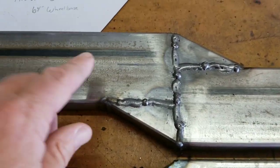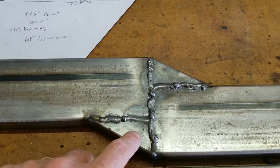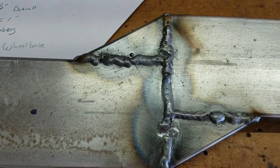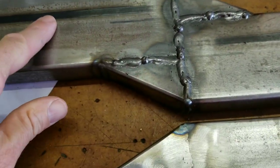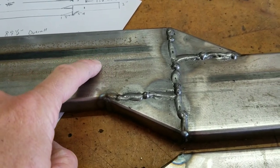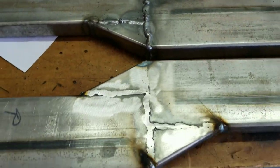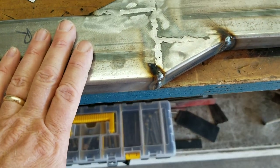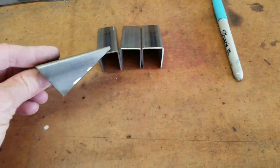My welds got progressively better and better. You can see some are a little high, but this one has nice penetration — see the bluing around it, that tells you there's a proper amount of heat in there. This side is even better. We'll smooth off the exterior side. The interior side, which has the line in it, goes to the inside so you don't see that — it can sometimes shadow through on paint. The inside area gets less grinding; we'll just smooth it off so the aluminum floor mounts cleanly.